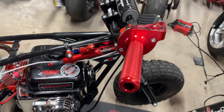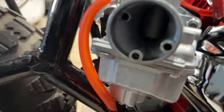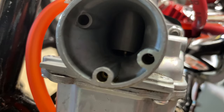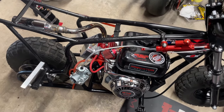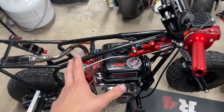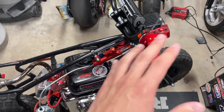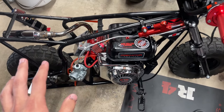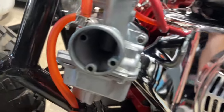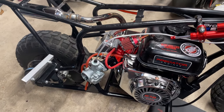It's so smooth — you won't get that from a regular plastic throttle. Whenever you install a new throttle cable, always take off your air filter and check the carb position — the slide should be all the way down. If the cable gets bound up, the slide can stick in the up position and the bike will take off on you when you pull-start it. Always put the bike against a block wall just in case.